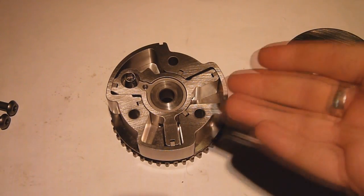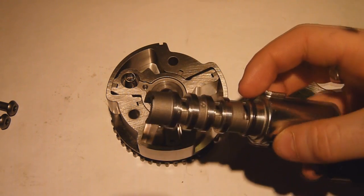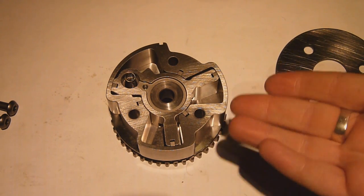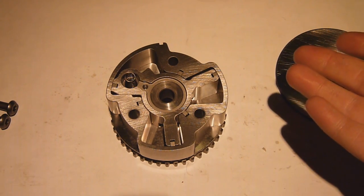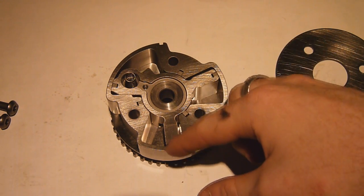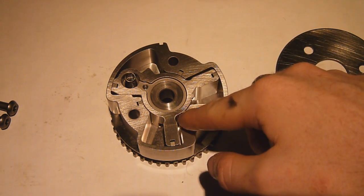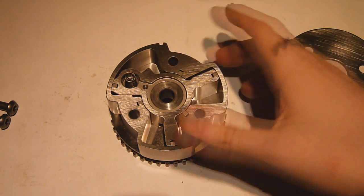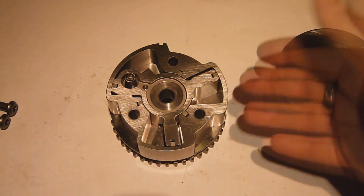And that's basically it - that's how simple this system is. By just using a hydraulic valve here, which is controlled off the ECU, it actuates the cam and varies the valve timing depending on engine speed, engine load, and so on and so forth. The only other features are some sealing blocks here, which are pressed against the stator and the actual housing via springs, to just keep the oil pressure in the places where it needs to be. It's just such a simple system.